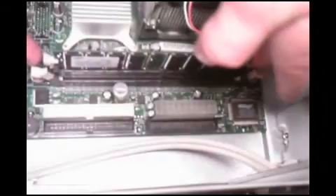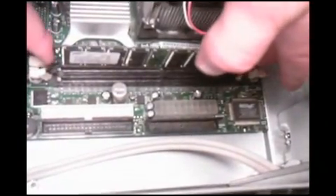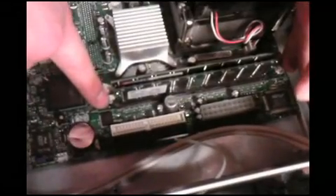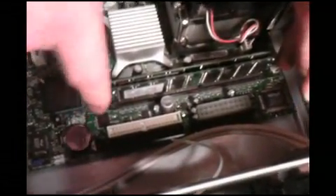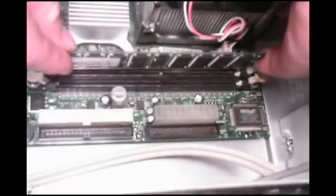In order to upgrade or replace your RAM memory, first ensure that the RAM you choose is compatible with your motherboard. For instance, my motherboard uses DDR2 memory, and only three types of DDR2 memory are compatible with my motherboard. Press down on the clips on both sides of the RAM cards — this will liberate and slightly raise the RAM. Then, grabbing from the sides, pull the cards out. RAM is installed the same way but in reverse. Notice the notches on the RAM card; let these notches guide which way the RAM should be placed in the slot. If you are trying to install incompatible RAM, these notches will disallow the installation.